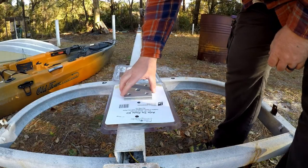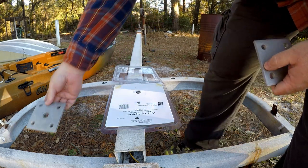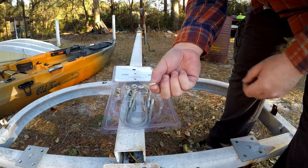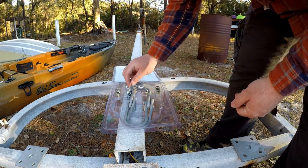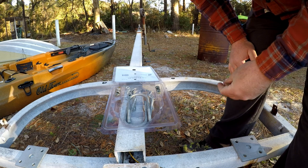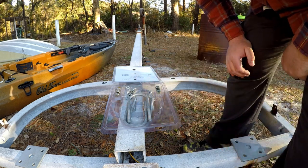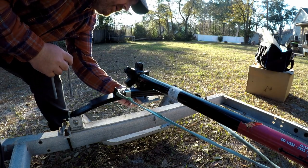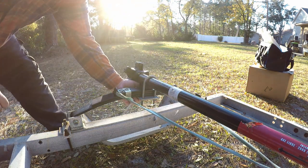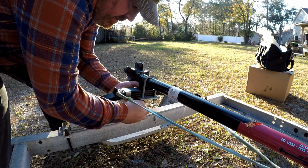In the pack there's a plate — it's a thick plate. There's a plate for each side, so one plate there and one plate over here. Then we have lock washers, regular washers, and our u-bolts. The basic idea is the plate goes there — there's a little hole in the bottom too — plate goes there, new bolt like that, and then bolt on the bottom.